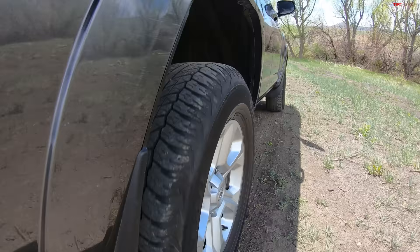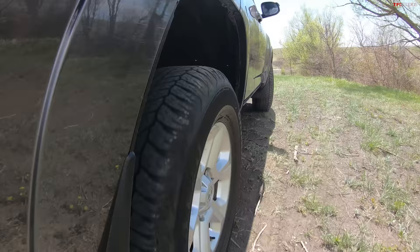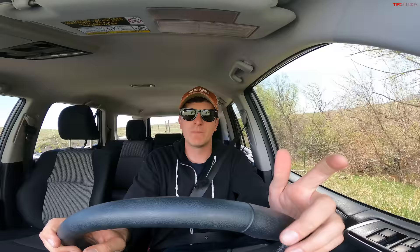Welcome to the Onyx Off-Road trenches course. We've got the 4Runner running through the course starting out in four-wheel drive high. This part-time system does offer some advantages over the full-time in the Lexus — part-time systems tend to be lighter, less complex, and rely less on traction control to distribute front and rear torque since that distribution is through a mechanical knob. The downside is you have to remember to switch the knob — like my dad's story of my mom in a third-gen 4Runner driving over Winter Pass in Colorado, forgetting to put it in four-high and almost spinning off the mountain.